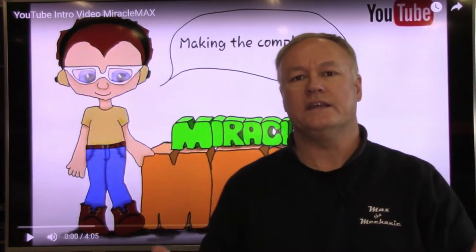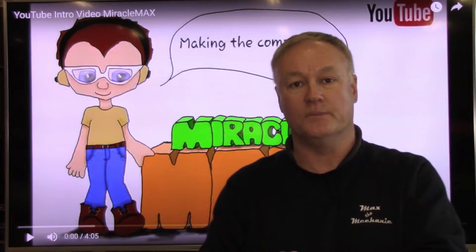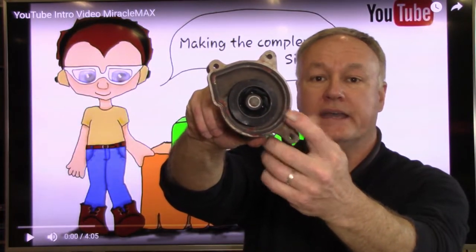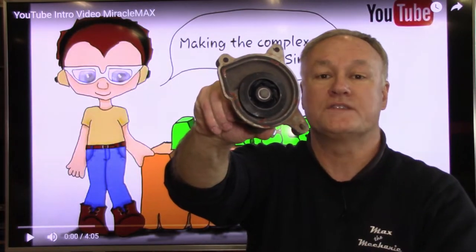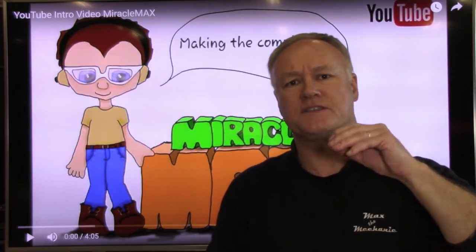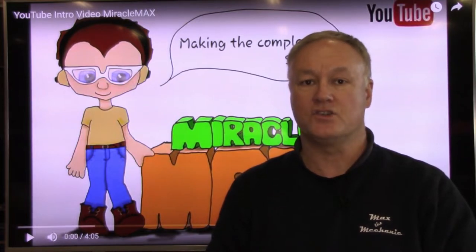The thing is, we need a simple test to figure out if the water pump is doing its job. Has it fallen apart inside? Has that stupid plastic impeller fallen off the back? It happens — it cracks and then it won't rotate, therefore causing overheating issues or some other reason that we can't account for. So we need to be able to see behind the scenes to figure out if our water pump is doing its job.